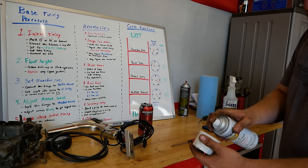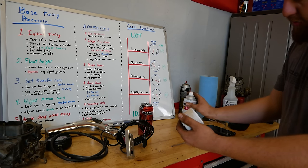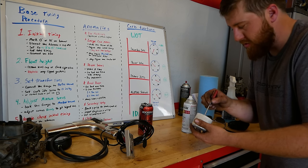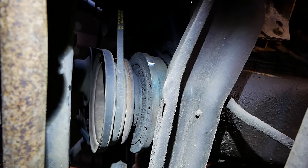If you don't have a paint pen, fill a cap with spray paint, use a screwdriver as a paintbrush. I used to have a paint pen but ran out in 2016 and literally never got a new one. There are some teeth right there and one of them is different — that one's zero. I've got that marked with paint, and likewise I've got one side of the crack on the harmonic highlighted so I can see it.